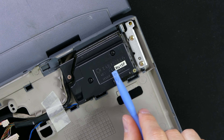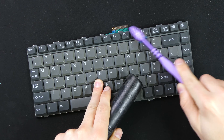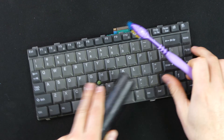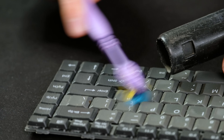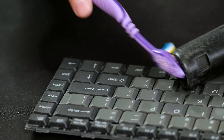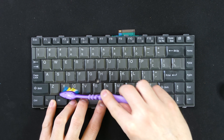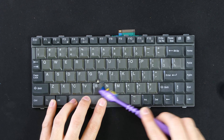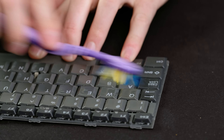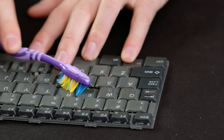The pair of stereo speakers also looked pretty serious in this laptop. Now for the fun part — to start cleaning the filthy keyboard, I brushed off all the dust and debris with the toothbrush. There's quite a bit built up under the keys as well, so I tried to be thorough. Step two again involves a toothbrush, this time with some isopropyl alcohol to remove gunk like spilled food and drink that's visible on the keycaps. As I always say, keyboards can be quite unhygienic — case in point, this keyboard.